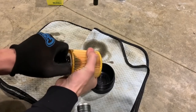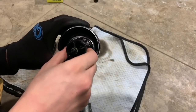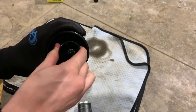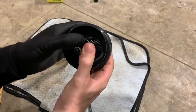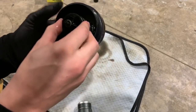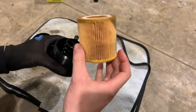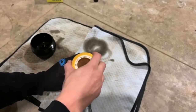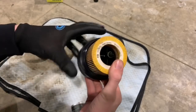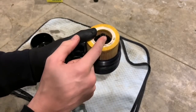This just gives the leverage that you need. Now we're going to install the stock cage that you took out — you're just going to line it right up with these clips, push down on one side, push down on the other side. It's very sturdy, actually a lot sturdier than the stock setup to be honest. Now we're going to take our brand new filter and put it on. Push it all the way in until it clicks in, just like the stock setup — nothing is different with this.